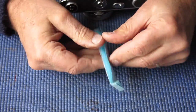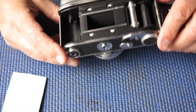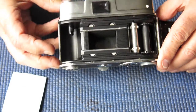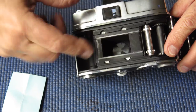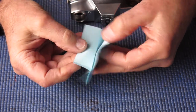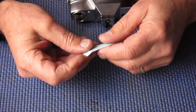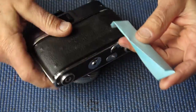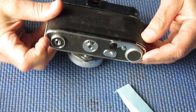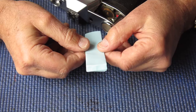So that was the answer in this case. The capping plate hung down at the back inside the camera and was obstructing the view of the back of the shutter. And a piece of paper folded twice, with the end folded over so I could hook it in at the back — crank the film advance — and that fixed the problem.